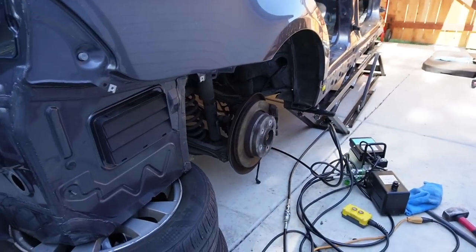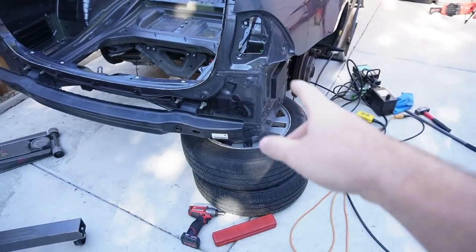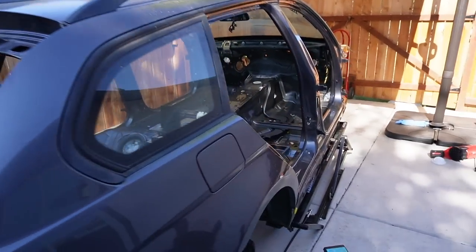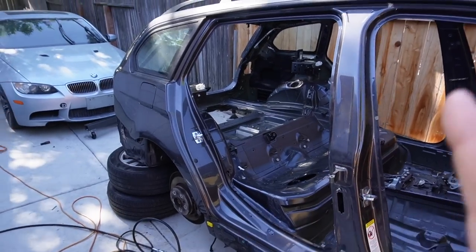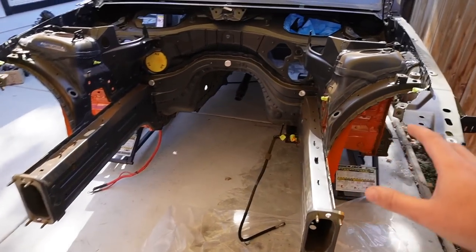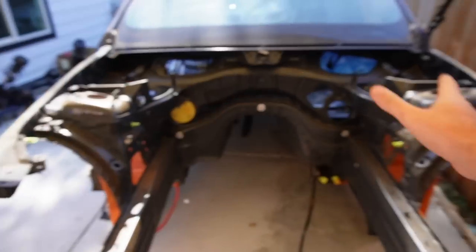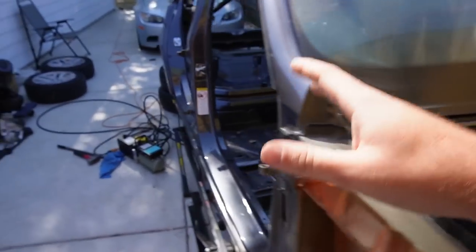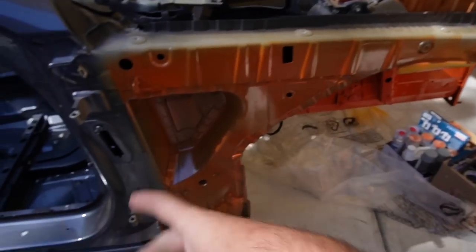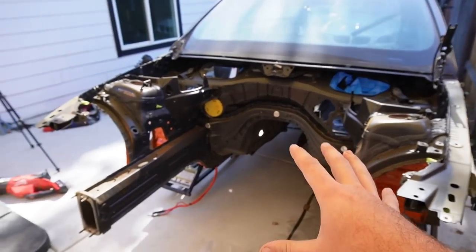About a day later, we got everything disconnected - brake lines, e-brake, driveshaft, all the sensor cables. We were going to drop the subframe last night but one of the quick jacks failed with all the weight on those two wheels and the car almost slid into the fence. We saved it though. Now the front frame rails are painted on both sides. The goal is to get this entire engine bay sanded while the weather is nice for paint. Later when it's super hot we can drop the rear subframe. The primary focus right now is prepping and painting the engine bay.